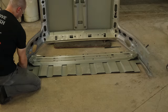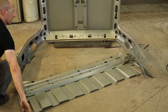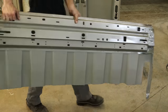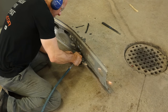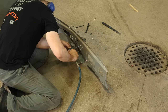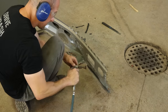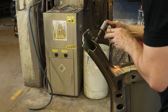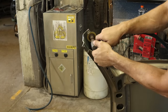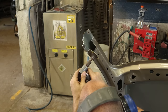Our pile's getting pretty big. We're going to slide this back cab panel out of here. Our two B pillars have those pieces that actually sandwich between the two pieces on our cab panel — that's going to make it fun to put together. Now we're going to start prepping everything. We have everything trimmed, so we're going to grind all our spot welds off — anything that was extra — and grind the other side that we're welding to, just so we have a nice surface with no contaminants. We're going to grind all of our seams on both sides to get all the paint out of the way. We don't want any of that stuff getting in our weld.